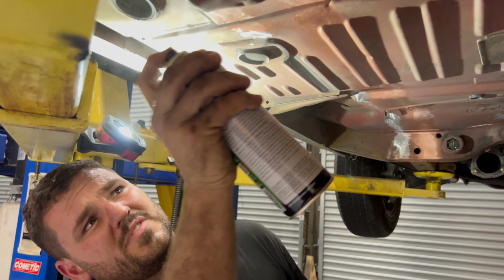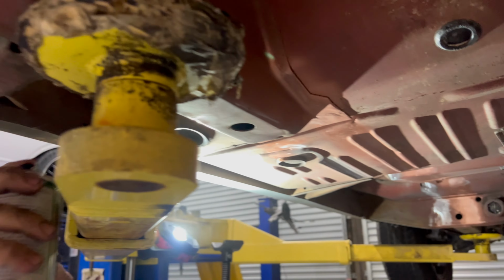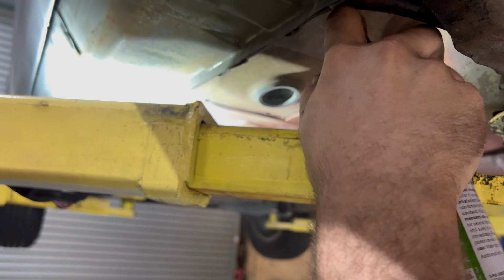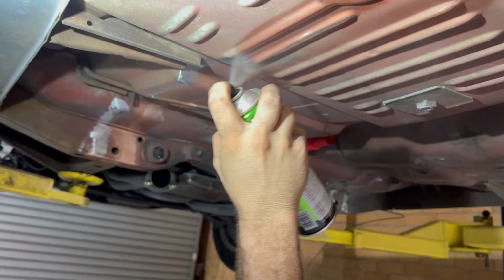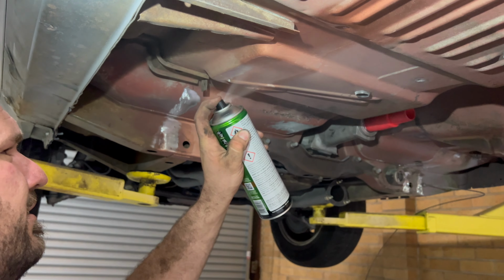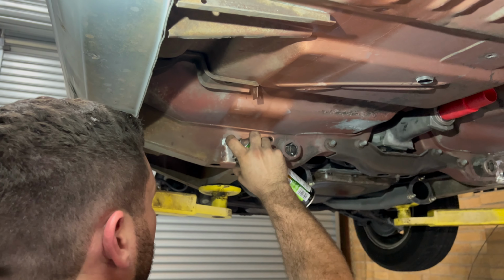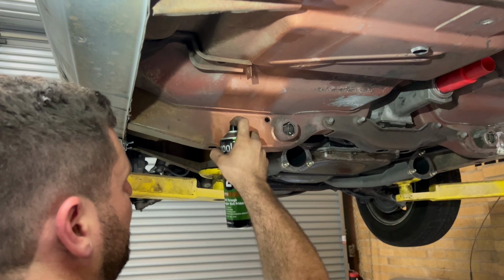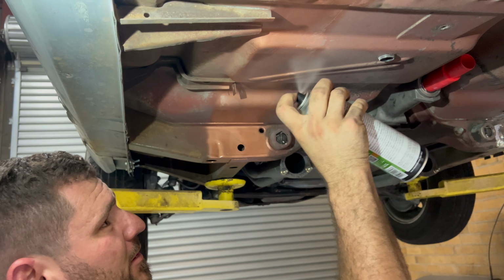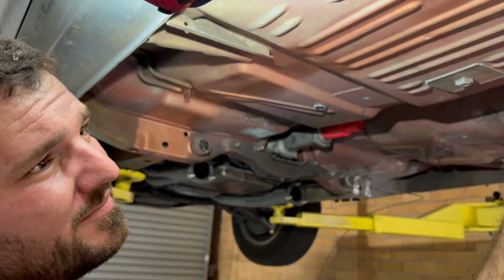So what are you spraying on here? Just a U-pol weld-through copper primer and such, or whatever you want to call it. Wherever we've brought back the bare steel, we're going to put this on so, one, it's sealed, and two, so we can weld through it and it seals up, not going to rust, corrode or anything else in the future. To basically just future-proof everything we're doing. Seeing as you've already gone through the effort to repair all the rust in the car. Exactly.